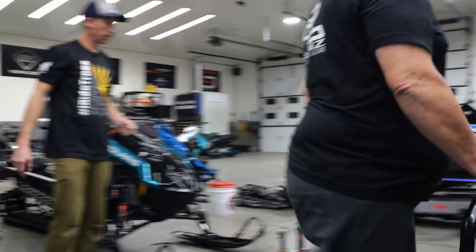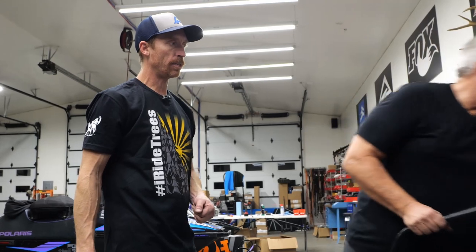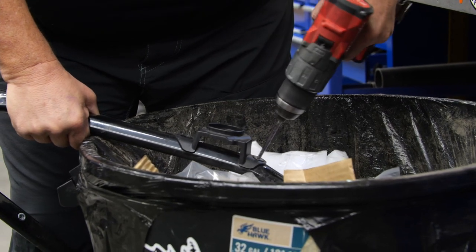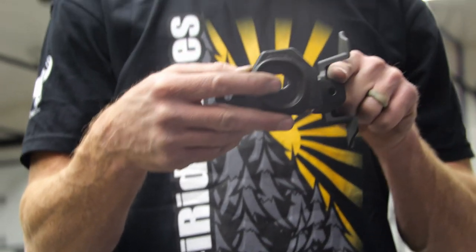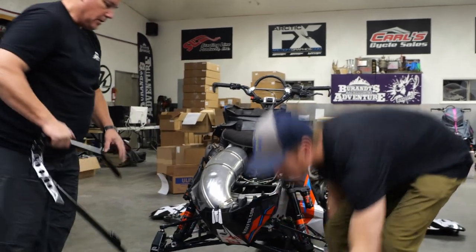Next, we're going to grab a drill with a 3/16th drill bit and basically drill just the head off of the rivets that hold the quarter-turn plastic retainer. Once you've got these plastic pieces off the bumper, one thing to note is there is an orientation for these — they are directional. It actually literally says 'front' on the bracket, so the hole that says front will go facing the front of the snowmobile, and we'll show you that on the bumper.